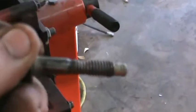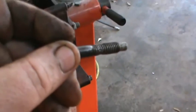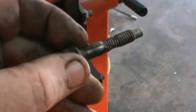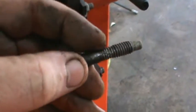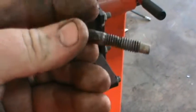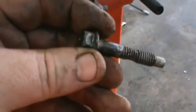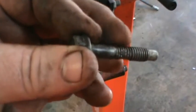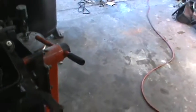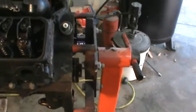You can see how this bolt is eaten up - that's the way it came out. It's really important that you pay attention and clean all the bolts you take off this engine, because when I put this thing back in and start to torque it down, it could snap right where it's weakened. Then I'd have to take the whole engine back apart and try to tap the bolt out without destroying the head - it could be a nightmare.